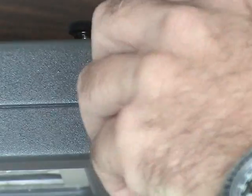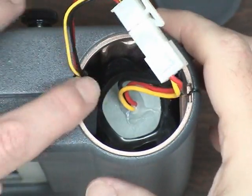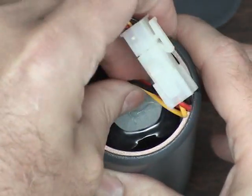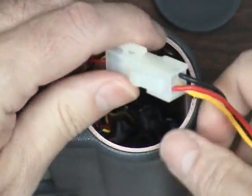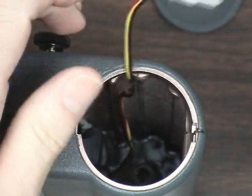To switch batteries, turn the instrument over and unscrew the battery cover, then pull out the wiring connector. Reach in with one finger and depress the button until the battery pops up. Grasp the battery wire and gently pull the battery free of the instrument. Release the connector by pressing the release button and pulling the connector apart.